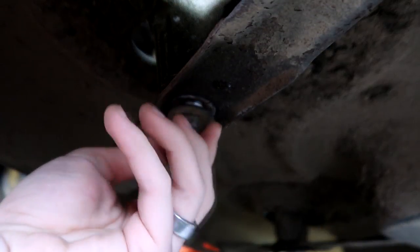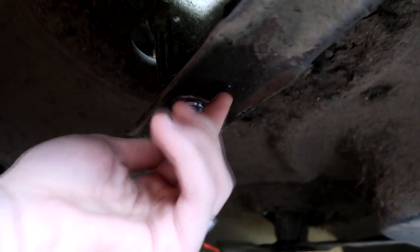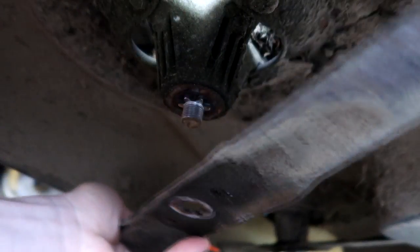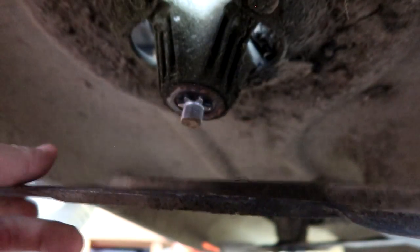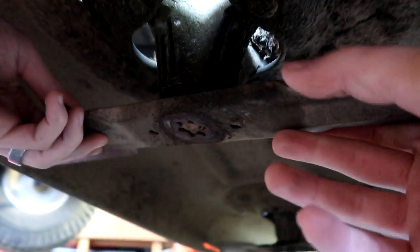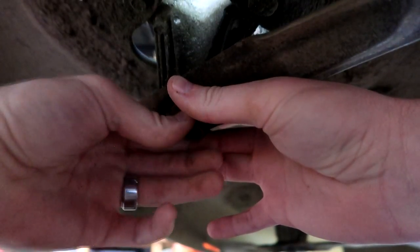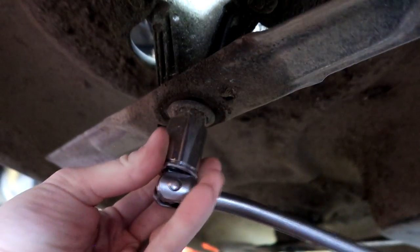Spin this nut off with your hands. You may have a washer in here, so you're going to want to be careful — don't just start ripping things apart, pay attention. See how easy that came off. You can see the blade has a little star drive there. Get your new blade, align it with the star shaft above, then spin the nut back on. Obviously you're going to want to tighten it up pretty good — you don't want lawn mower blades flying off and hitting the dog or whatever.